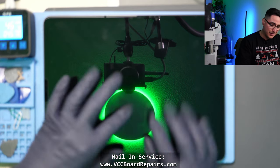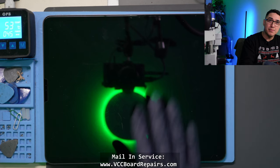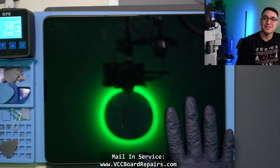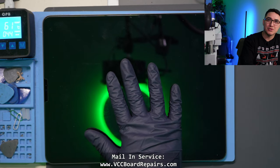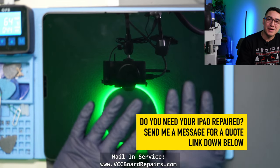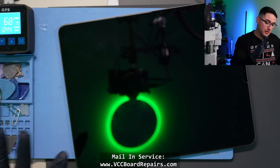You've got to do it very carefully because there's a very tiny bezel — maybe half an inch — of clearance to insert your tool to separate it. If you go in too deep, you're going to damage the LCD. If you bend it too hard, you can crack the glass. This screen specifically costs around $310 at my repair shop price, so you need the skills and experience to open these. It takes practice to master this skill, and if you try and fail, we do offer screen repairs as well.